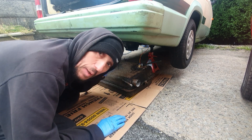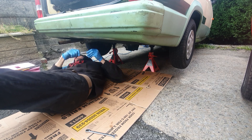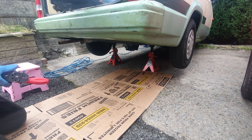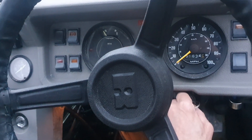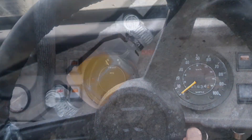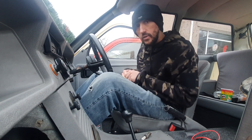Now I've got the joyous occasion of putting it back up. After changing the tank and the carburetor, the car's not starting at all. I've run through a few things and even swapped to a different carburetor - still getting the same symptoms. The car is just turning over, not trying to fire at all. It's the next day, just in case I've flooded it. Choke is out. Doesn't even seem to be firing. Definitely getting fuel from the tank. This is extremely frustrating.